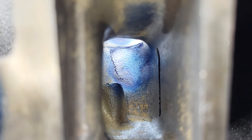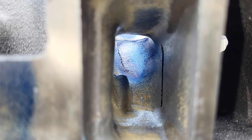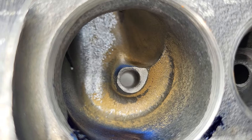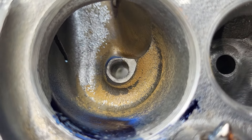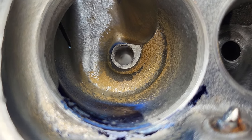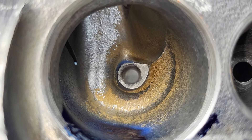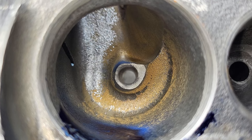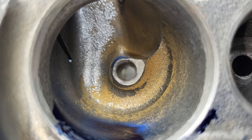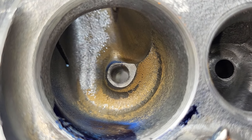I really was expecting this to take off quite a bit and it didn't. I really have to look at the airspeeds and see what's up. I poured it before I cut that bolt hole open — I thought it would be around 205 cc's. It was 213.5 cc's, which is a little generous for what it flows. It's a different design, so it's not quite as efficient as a regular straight port. But that doesn't mean it won't make good power — it probably has much better combustion efficiency than a straight port, so you have to add that into the equation.